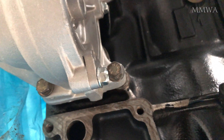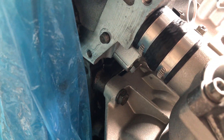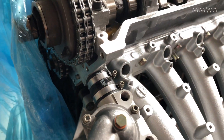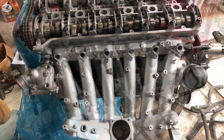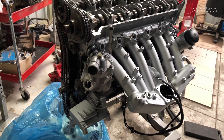You'll notice that the water pump now has hex head bolts holding it instead of allen head bolts. They fit and they work — I don't know why they didn't do this from the factory. Allen head bolts are so easy to strip out, and this way you can easily fit a small ring spanner in there and loosen them. So if I ever need to take that pump off again it's going to be a piece of cake.